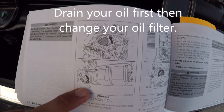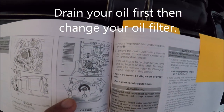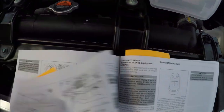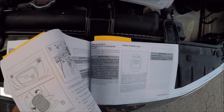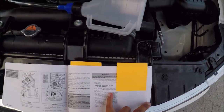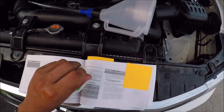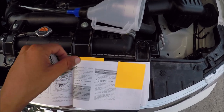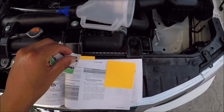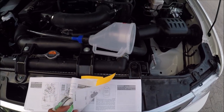Here's a reference picture showing where the oil drain plug is located — for the VQ40DE oil pan it's right here, and for the QR25DE it's right there on the side. The torque specification for the oil drain plug is 25 foot-pounds or 34 Nm. Typically I just tighten it until I feel the bolt stop turning and then give it a quarter turn more.